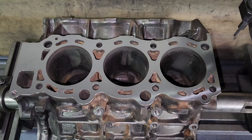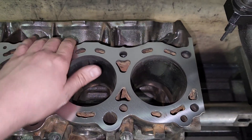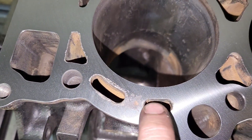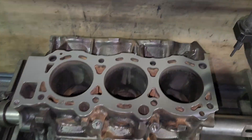This side cleaned up at six and a half thousandths. I ended up deburring the edge too — it just makes it look a little bit better and doesn't leave that sharp edge. So this thing's good to go. It still has a little bit of erosion between these two water jackets, but that's not going to affect anything. So let's flip it over and do the other side.